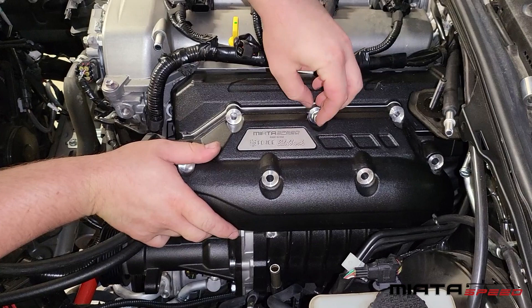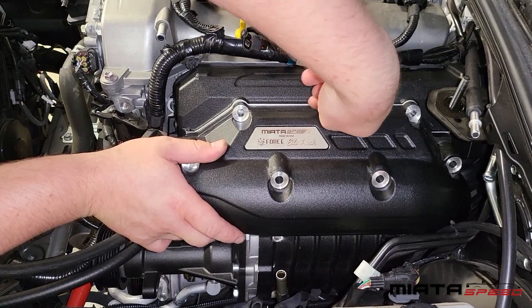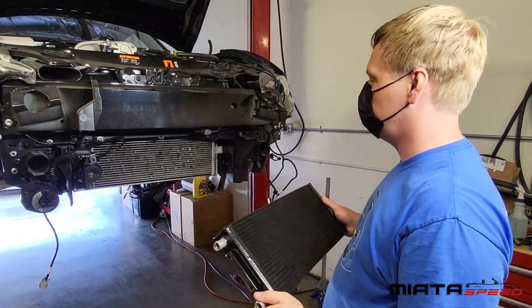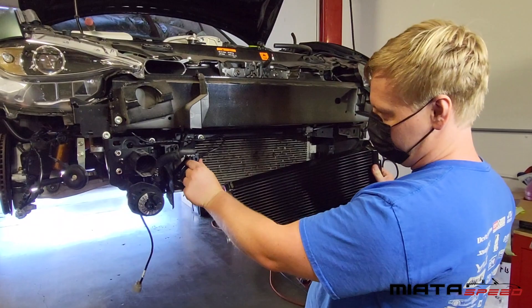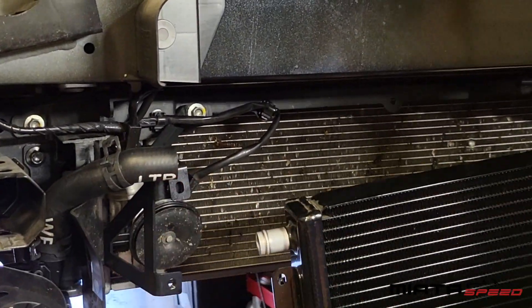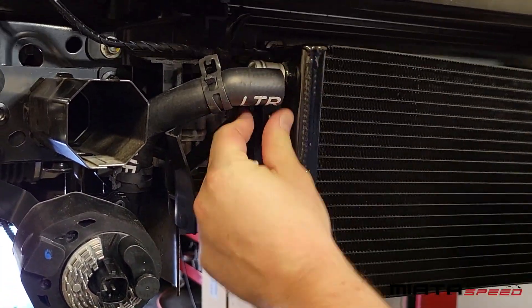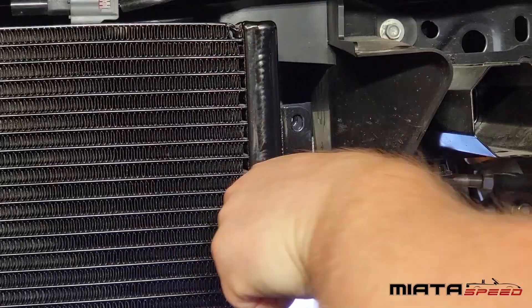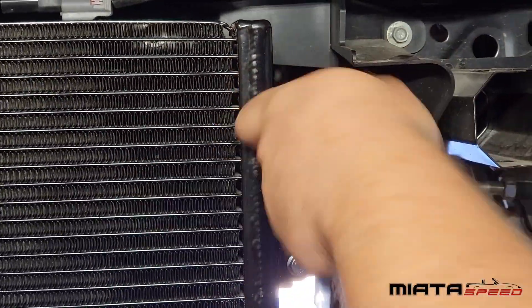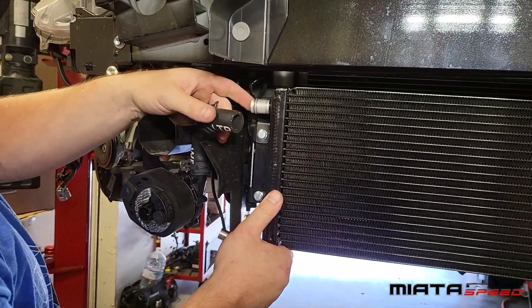It's wise to have some of your top bolts handy for this stage. When you're putting in the intercooler — or charge cooler, the water-to-air charge cooler — I like to leave this a little loose. It just gives you a little more leeway as you get everything together. I would suggest pushing this as high up as possible to get as much clearance for this hose as you can.